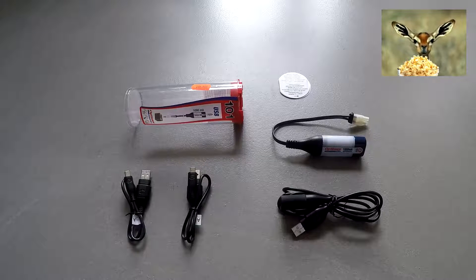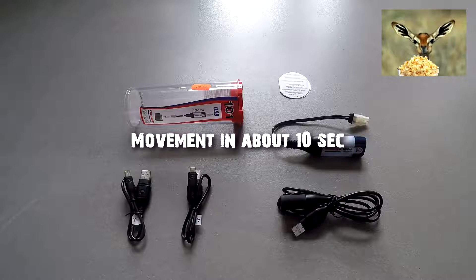There's also a possibility to charge two items on your bike, but I will mention more about that later. Now you can't just connect a USB cable somewhere in the electric system because a motorcycle has a 12V battery and your device only uses 5V. So you need some sort of a converter.